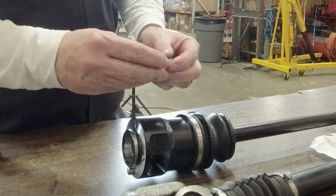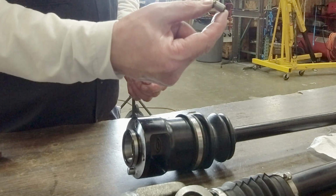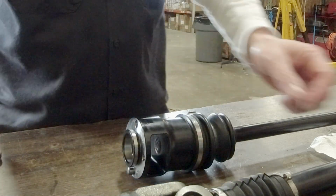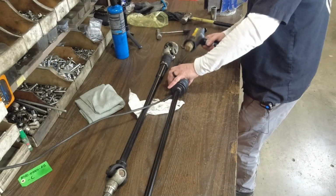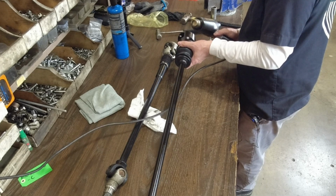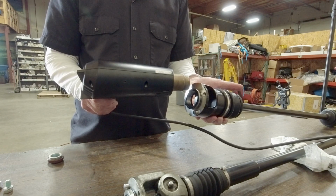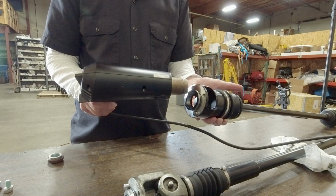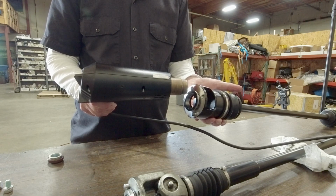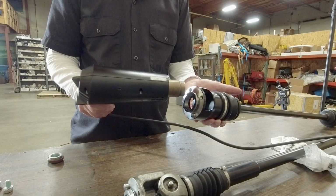Now you can also, in addition to putting the hardened dowel pins into the freezer and making them cold, apply a little heat. If all you have is a propane torch, you can do that. Just watch the finish that you don't burn it. But if you heat that area up, even if the dowels are at room temperature, you should still have the same success I had with the first one.